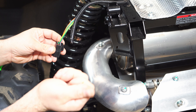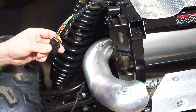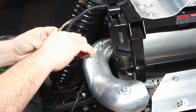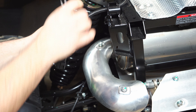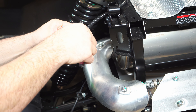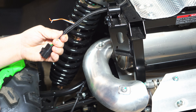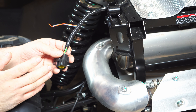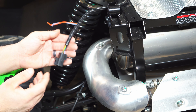In the back where it plugs into the bed, we're going to be after the orange wire again — that's the driver's side. Clip it. And the baby blue wire, which is passenger side — clip it. Now we're going to pull those out of that harness, put these back, and tape this back up. You can do this on the bedside, though we're going to do it a little differently because the bed's full — this is just to show you.